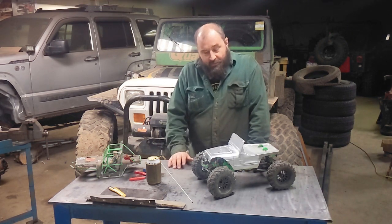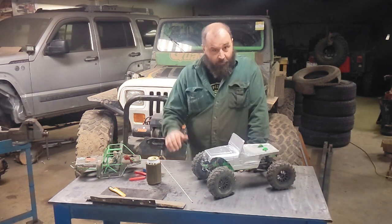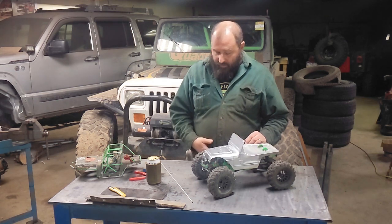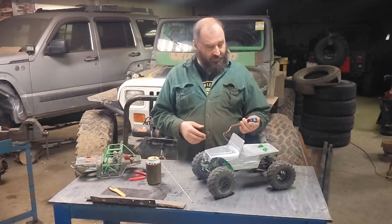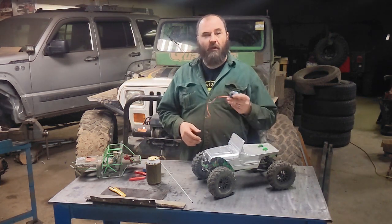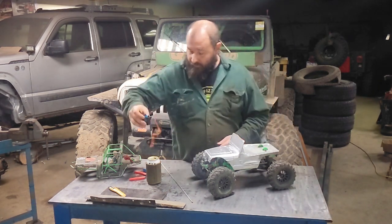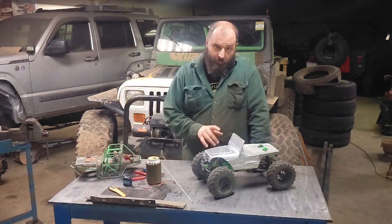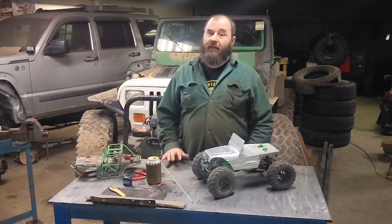So aside from that, I've been dealing with some other issues with this — my steering has been terrible. I burn up a decent servo, probably operator error. Then I just robbed the Red Cat servo out of another car, put it in there, and I've killed that thing. I've got track bar issues, just a lot of steering problems that have really held me back in the comps. So I bought this 35 kilogram Zosuke servo off Amazon — I'll leave a link below. From all the reviews I saw on other YouTube channels, it's about the best servo you can buy when you're on a budget. This was $40; a good servo is $150. I also added a BEC — a device that allows me to send full battery power to my receiver, which then sends it out to my devices such as my servo. So it's going to give me a lot more steering strength.